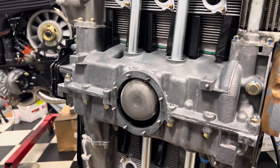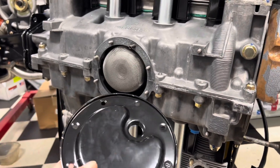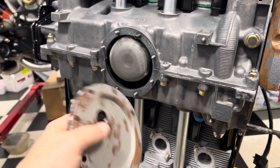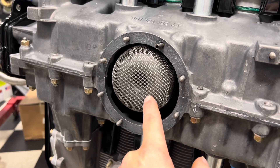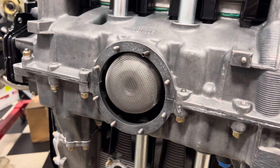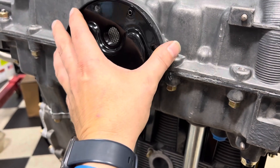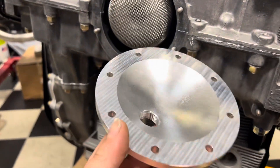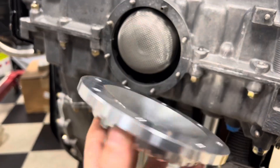We're on our last step for what we've been asked to do, which is install the sump plate. Now, the original sump plates on these earlier cars were flat. The problem is, what we did here was we put in an upgraded — I think this was a 964 part number — oil pump. So it has an integrated screen; it's not the screen that comes out. So in order to make room for that, the flat plate is already making contact right there.